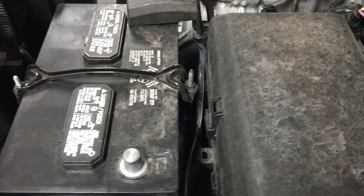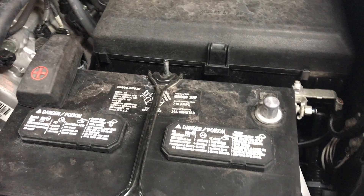Be sure to disconnect the battery before you do anything with the truck, just to ensure everything is safe — especially with these newer systems. It's commonly known that you can trip the airbag light if the negative is on the battery and you disconnect any harness related to the airbag.